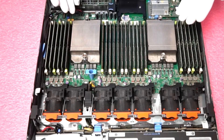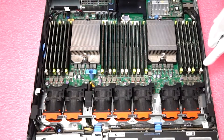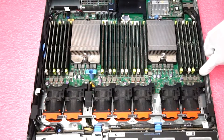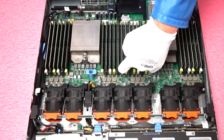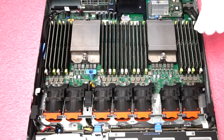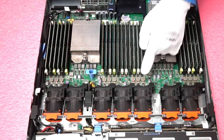If you are only loading 8 DIMMs across the 24 slots, you would want to put a module in each one of the white slots. The white slot is the first slot of the channel. If you were to try to load them all in the green slots, it would give you an error and it would not load — so you need to put them in the white.